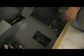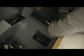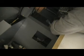And as you can tell by me being able to turn this bolt, it's still in that position even after flying the 40 hours, which means that there's no movement of the spar inside of the center section. Otherwise I wouldn't be able to turn this bolt. Or on the other hand, it wallowed out the hole, which I doubt very seriously. So when I get this out, I'm going to pull this bolt.